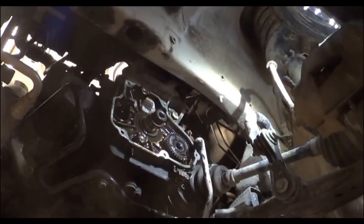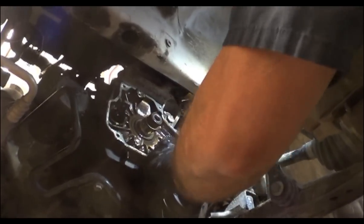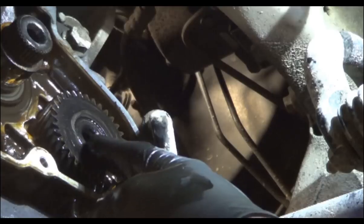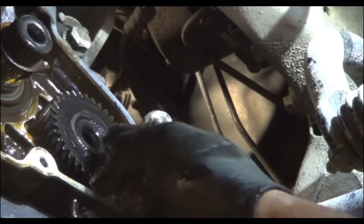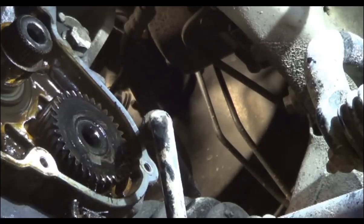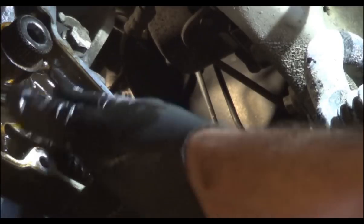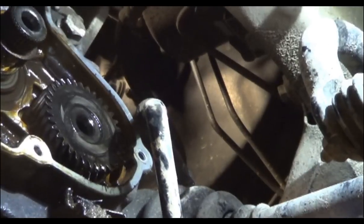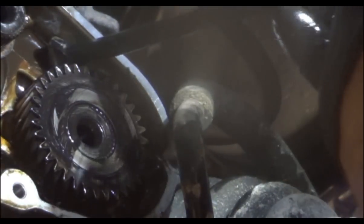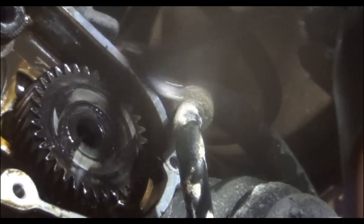The next gear is always the harder one. These gears do have a tendency to strip out. There's a set of splines right here — I've seen it on the internet multiple times where it loses fifth gear, just goes into neutral when you put it in fifth and these splines are stripped out. Sometimes the gear alone is damaged, sometimes the shaft is damaged. Shaft damage means you've got to pull the trans apart — major repair. If just the gear is stripped, you can replace the gear.